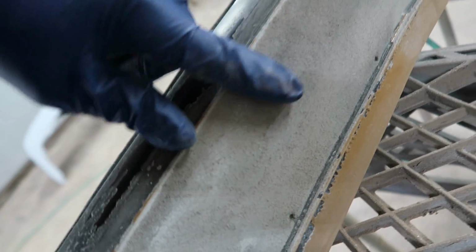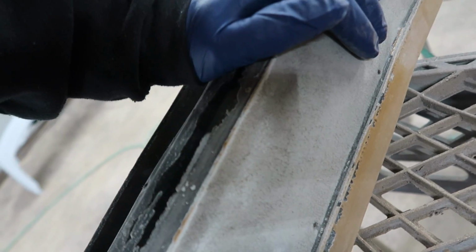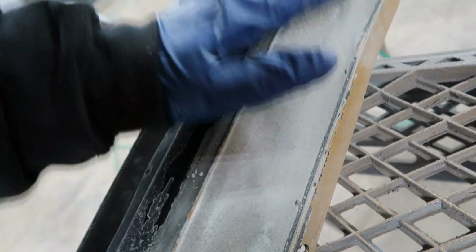While I'm going over this thing, I'm using 40 grit. 40 grit is super aggressive, especially on top of plastic, but it is taking all the old paint off. It is making the plastic really rough also, so it's gonna be a lot of work to get it worked back out smooth. But I feel pretty confident that I'm gonna be able to do it.